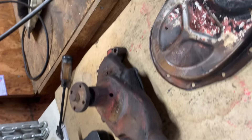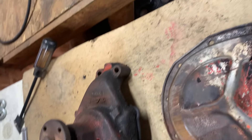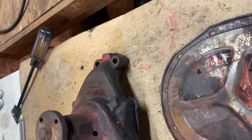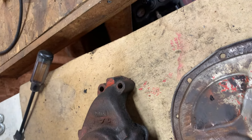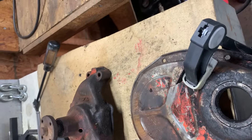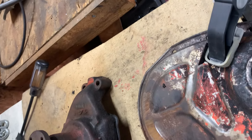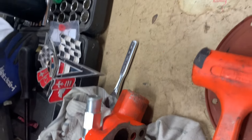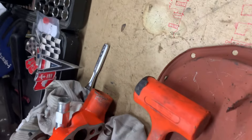I'm not saying that the cam is not walking, but I don't think that those marks are a result of that. I think that's just the way it is. I've measured both of these pumps to check the heights on them, to see if this pump right here had possibly been milled down, making it shorter and tying it up against the timing cover. And I don't think that's the case.